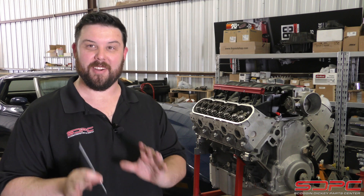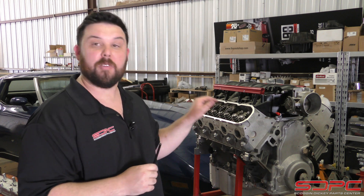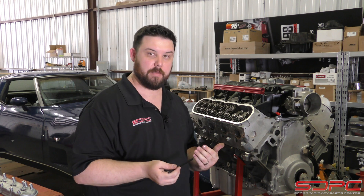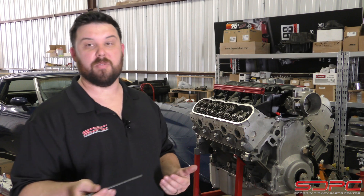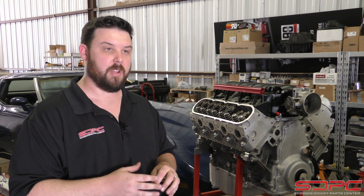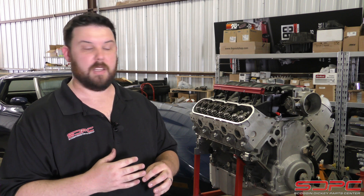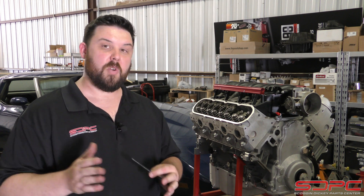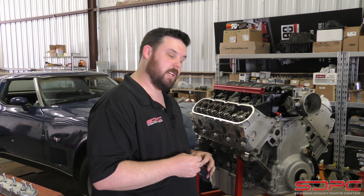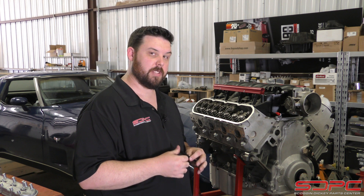But don't buy 7300 pushrods just yet — you'll get it wrong. Lifter preload, like I was saying earlier. I could go 7350, 7375, or even 7400. Remember, it's a wide range. The manufacturer says anywhere between 30 to 60,000 on LS7 lifters, and most shops that put these together — and the experience that we've had — actually about 50,000 to right at 100,000 is a good preload as well. It's 200,000 total is what that plunger will move inside that lifter, so you've got a lot of wiggle room. It's pretty forgiving. I can actually pick a 7350 or 7400, but I'm not exactly done.